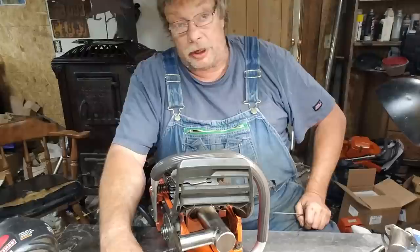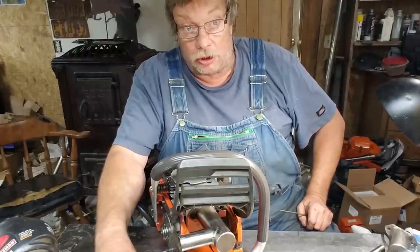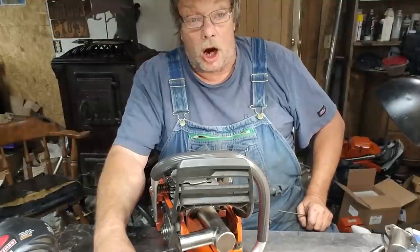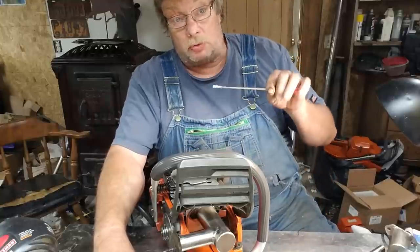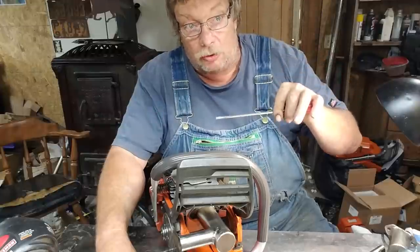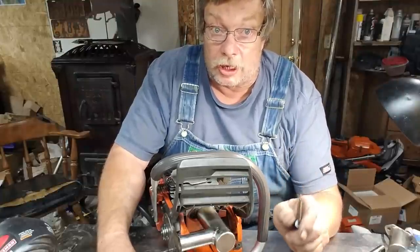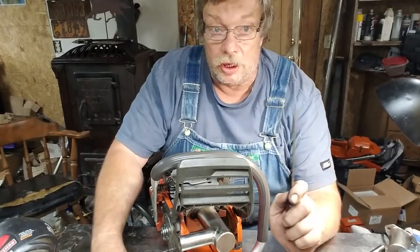So instead of putting on 96 or 97, 98, something like that, this saw is running 101 on the exhaust, and a fairly conservative 155 total intake opening. That means when the piston skirt starts to break to when it comes back down is 155 degrees on this saw. You know what I do to the intakes. You've seen my little notch. Done it to this one. You know, the two little notches in the rough. Done it to this one.